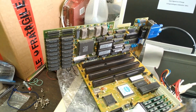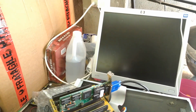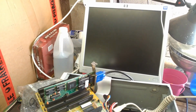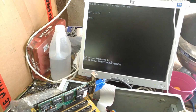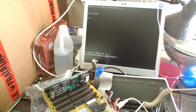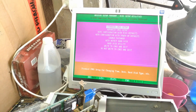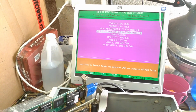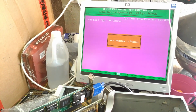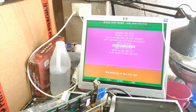Is this only like a 15 kilohertz VGA card or something? Okay, it's not liking that graphics card either, but again I don't know if the graphics card's cactus or if it's something else going on, so I might try another slot. The classic vintage computer thing where if at first you don't succeed, try another slot. There's some very odd, yeah, a little bit glitchy, the picture, probably can't see it, but let's try auto detecting the hard disk. Still not detecting that hard disk.